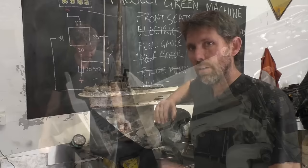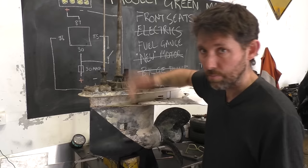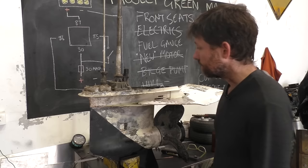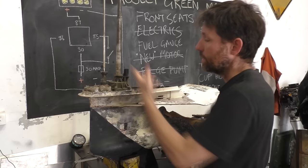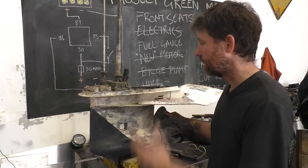We can see this is in forward gear because on these Evinrudes, lifting this selecting rod up goes into forward. You can see there's a bit of a shiny patch on the bottom here, so obviously it's in its raised position. If I turn the prop clockwise, the drive shaft turns clockwise. What I'm going to do is try and push this down whilst turning the prop just so the dog clutch engages and see if we can get it into neutral. I couldn't get it into forward gear in the boat, but it's clearly in forward gear now — so it may have just needed to be shifted between the gears a little bit to free up. And while I'm here, I'd be nuts not to look at the impeller — 80% of the effort is taking the gearbox off, so I might as well check what condition it's in.